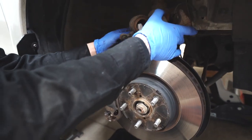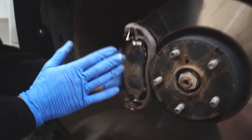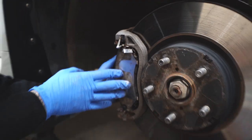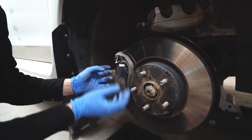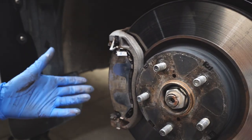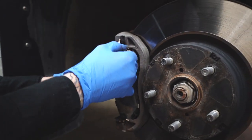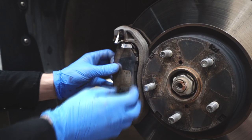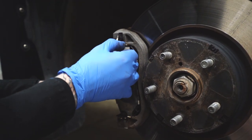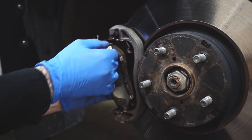It's really important not to let the brake caliper hang from the rubber line because you could damage it internally. Basically, when you push your brake pedal it compresses the two pistons and these brake pads slide in these channels. Usually what happens is these channels lose lubrication and essentially they're riding on metal on metal, so every time you release or press the brake pedal the pad moves slightly and creates that squealing noise.